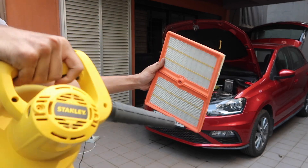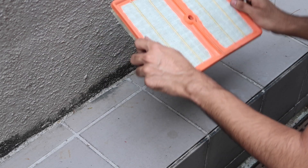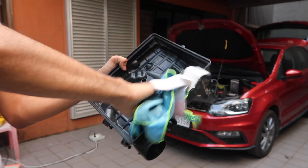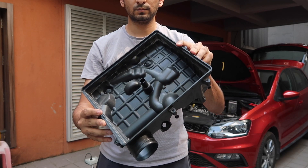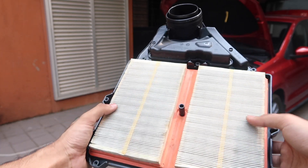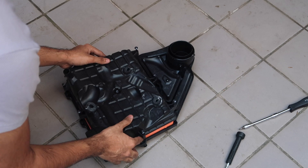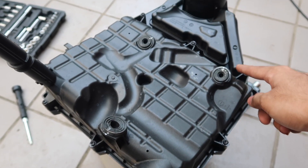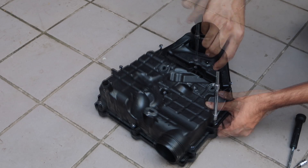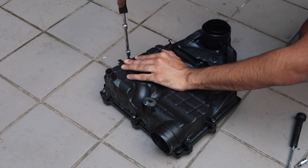All I'm going to do now is clean it with some air, but you could also just tap it clean against the floor. Now's a good chance to clean the entire air filter box thoroughly with a rag before you proceed to seat the replaced or cleaned air filter back in the air box. Then we put the lid back on and start tightening the eight T25 screws on the cover in a criss-cross pattern to avoid cross-threading and to ensure that the air filter box is properly seated.